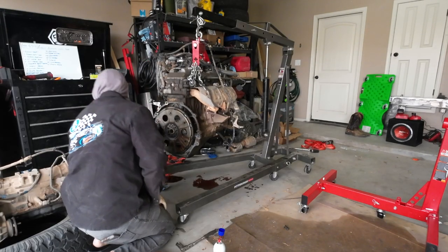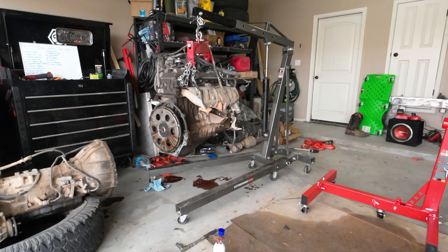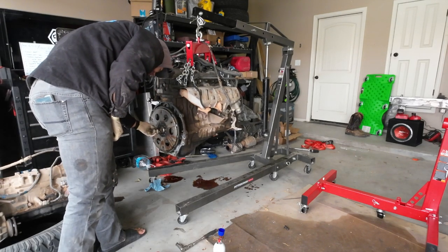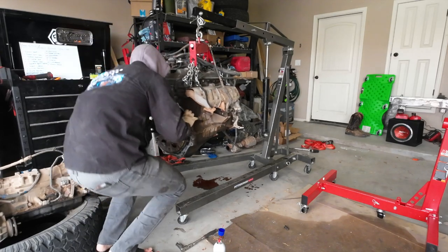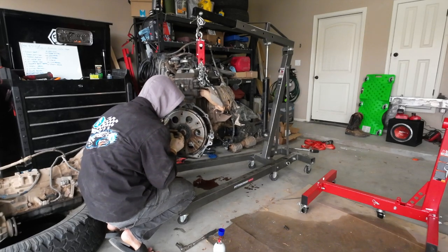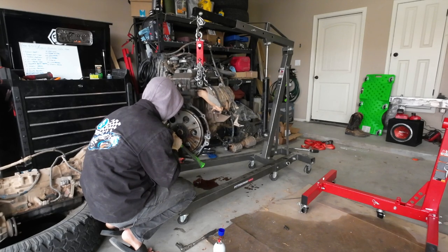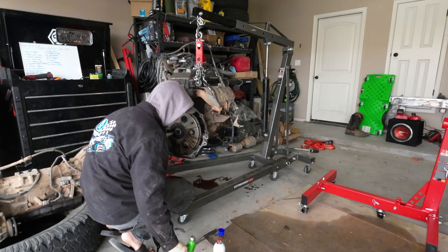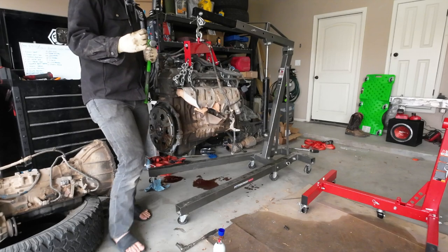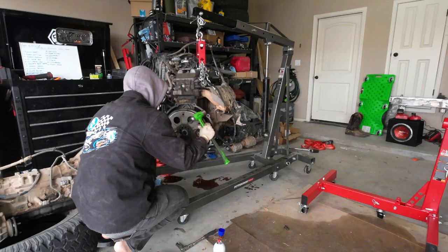That, it's not looking great. I'm gonna try a hammer and impact 13 on here and see if I can get away with this. I actually broke one of my chrome sockets, guys. First time ever. Okay, so I'm trying a 6-point right now. I think I'm just gonna skip that and go straight to my old reliable, my makeshift extraction set, and then I'm going to try to impact it out.